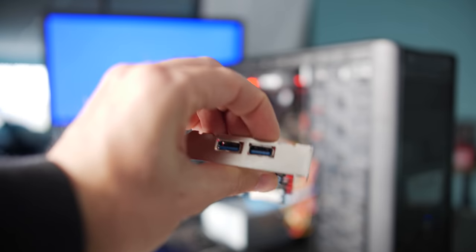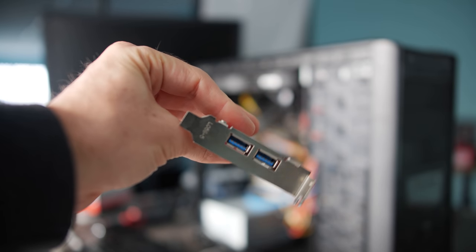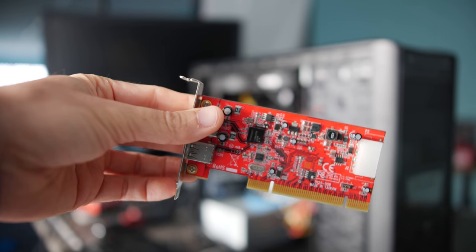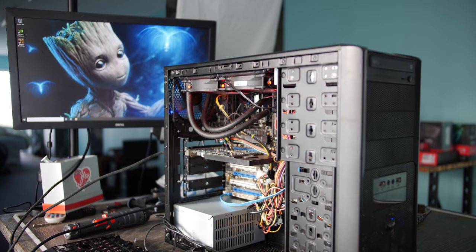There's also the possibility of bad USB ports or bad on-board audio. In those cases you've got PCIe add-in cards — even original PCIe USB expansion cards and PCIe sound cards. You might think that adds cost to a build, but if you're buying a lot of used components over time you'll come into this stuff for free. I find little SATA add-in cards and sound cards in old x58 systems all the time — those bigger cases come loaded with extras that 99.9% of people don't need in a gaming PC.